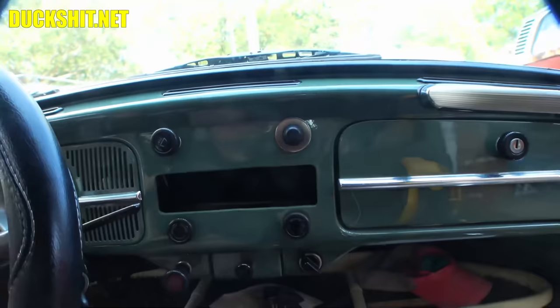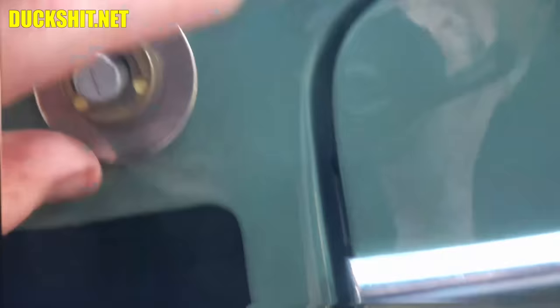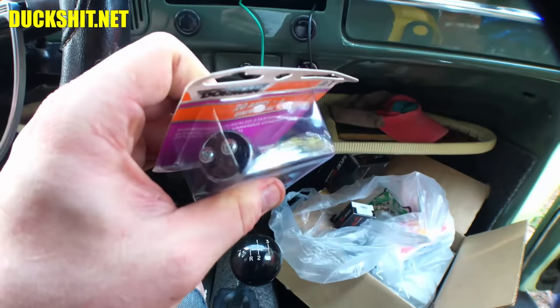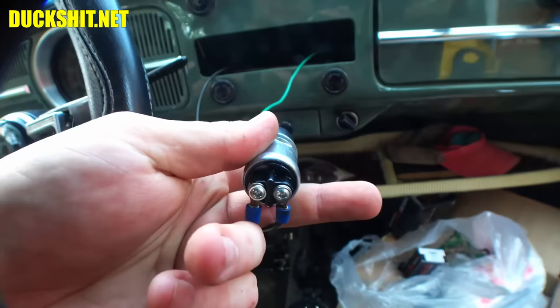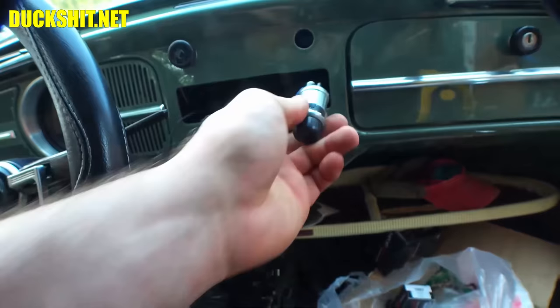Let's figure out what takes this apart. It has a rubber boot over the top of it. Looks like it's got some kind of a nut — unless the nut's on the back side. Let's try to unscrew it and see what happens. It looks like it's unscrewing. The battery's disconnected, by the way, because we are working with high-amperage stuff that's typically not fuse-protected. Yeah, there it is. That wasn't so bad. There's our switch. Looks like it's going to be two Phillips-head screws and the new one is also just two Phillips-head screws. Let's get that installed. Anybody can pull a screw out and swap wires on these things. Let me disconnect the battery again before I slide this up in the dash — I don't want to accidentally ground out on something and cause a fire.